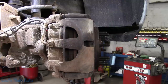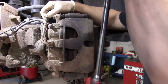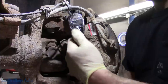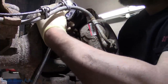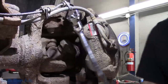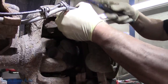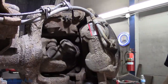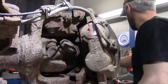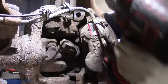Now we can bust the caliper loose — that uses a big 24mm. Look at the bolts loose on that. Harbor Freight does not have enough mustard to crack these loose, so use a big bar. Usually these things are wicked tight. Once they're loose you can zip them out with the impact. They're big jumbo bolts.